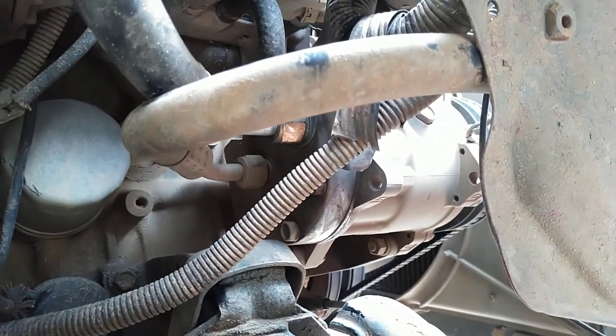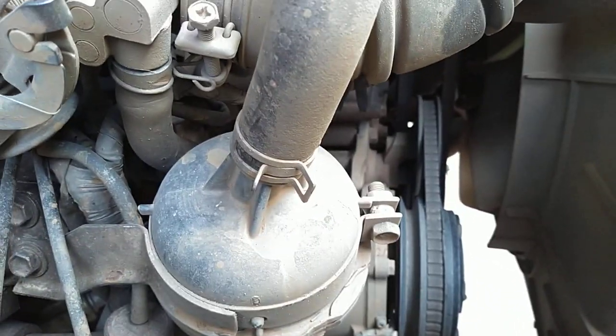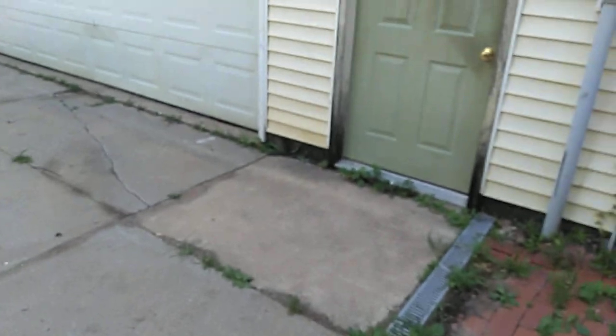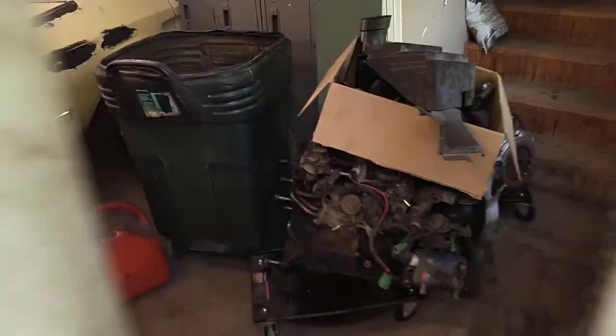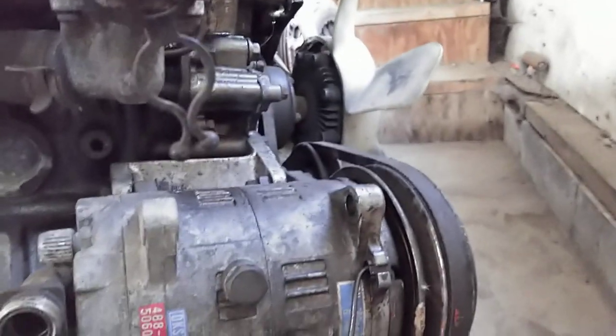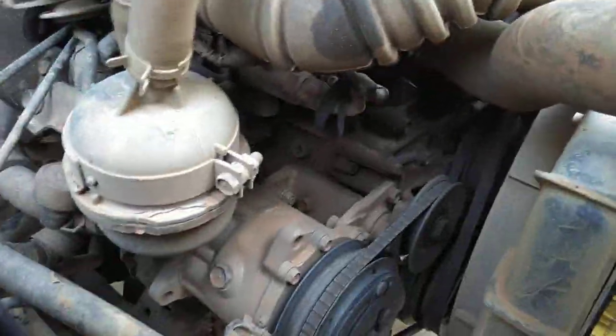The back side of it, and it's mounted on an aftermarket AC style compressor bracket assembly, which these are a huge nightmare to find new. Let me get a better view of one, because I actually have two of these. These are a huge pain to find because they're only used on aftermarket AC systems. This one has pretty much the same compressor, but this one's older. But you can see this is the bracket here. And also, this tensioner pulley is a lot easier to get to on these versus the Toyota one, because the Toyota one has a bolt that points down towards the frame and is hard to tighten, at least on the two-wheel drives. This is a four-wheel drive, so I don't think the clearance is as bad. But on two-wheel drives, they really suck because the bolt's pointed in a bad spot. Yeah, these aren't as bad.